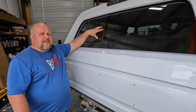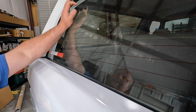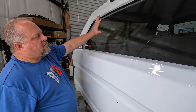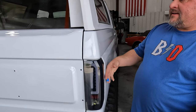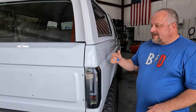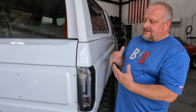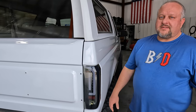The rear glass is probably the next video in this series — we already have it here with seals and everything. We're going to swap it out and get rid of this pitted glass; all these dried-out rubber seals are causing scratching. Right in here where we removed all the tire carrier holes, it's super clean now. A lot of trucks have those and they start rusting badly, so if you're not using the original spare tire carrier, I highly recommend you go ahead and delete those holes — they're just a spot for rust to start.